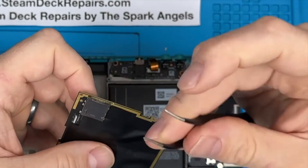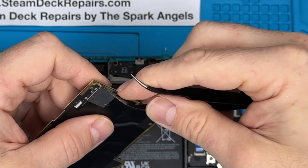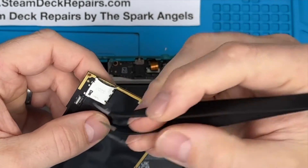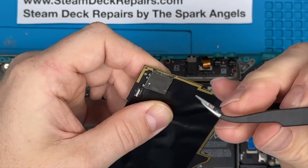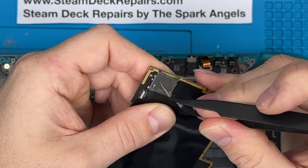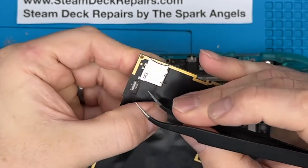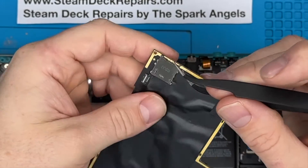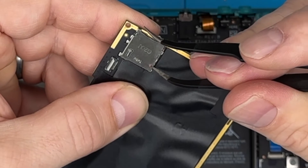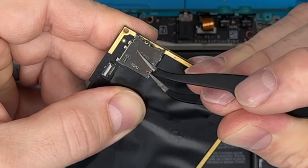I experimented with quite a few ways, because normally there's a little bit more sticking out and you can pull it — so this is my guide to actually removing it. You'll need a small pair of tweezers. This here is the detent — the spring that holds it in place — and that is the only real entry point to where the card is, because everywhere else is closed off. Get the tweezers in there; you can just see a very corner of the card there.